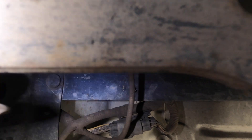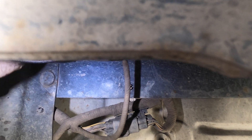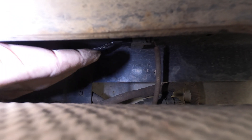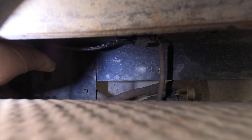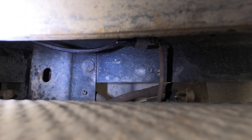There's a tab just like the back one you saw. I pushed on it with my pick and grabbed a pair of needle nose pliers and pulled on the wire to pull the connector out. I grabbed my needle nose, grabbed it, plugged it back in, and pushed it in with my pick on the end to make sure it's locked in. She's good to go.